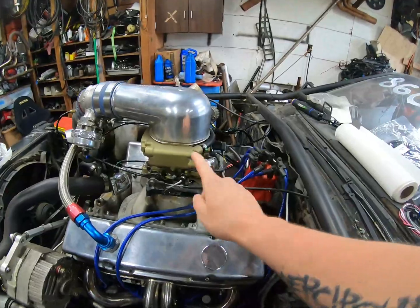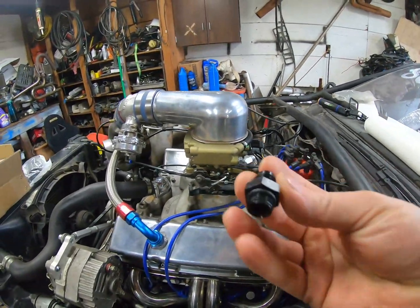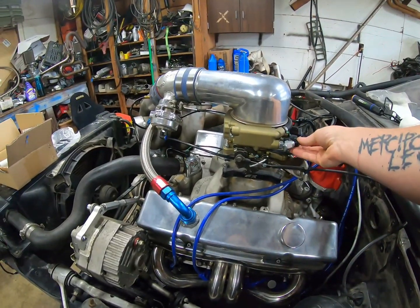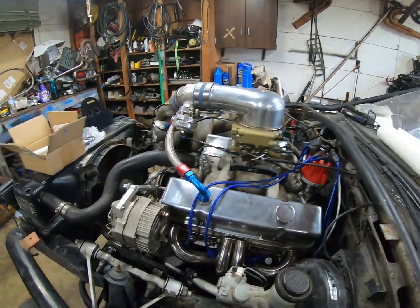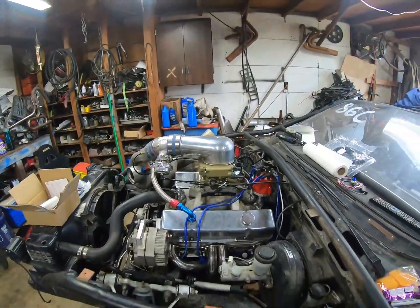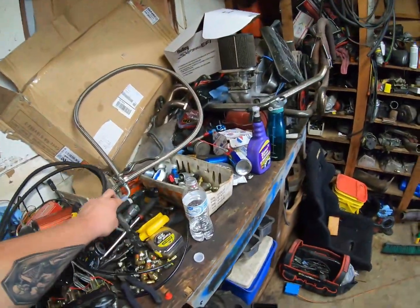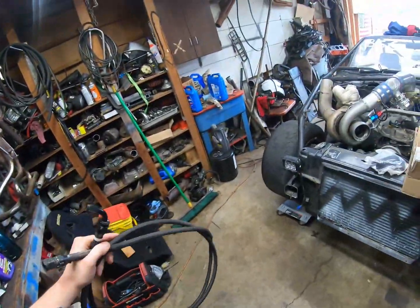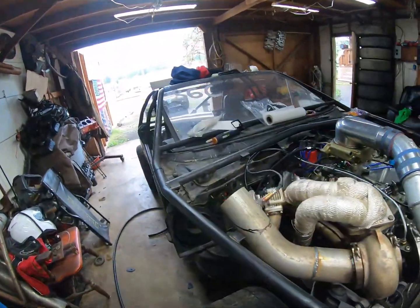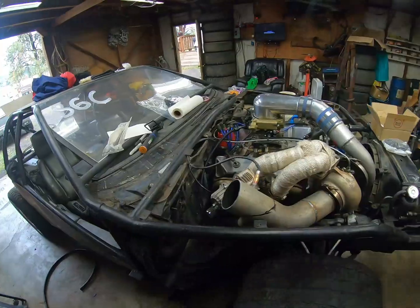So I got this instead of this guy, so I can use a straight off of here instead of a 45. Anyways, I'll get the pump mounted and the feed line ran, because I got my 8 feed line right here. Just got to put it in the car, mount the pump, and head that direction. Everything will be pretty good pretty quick.